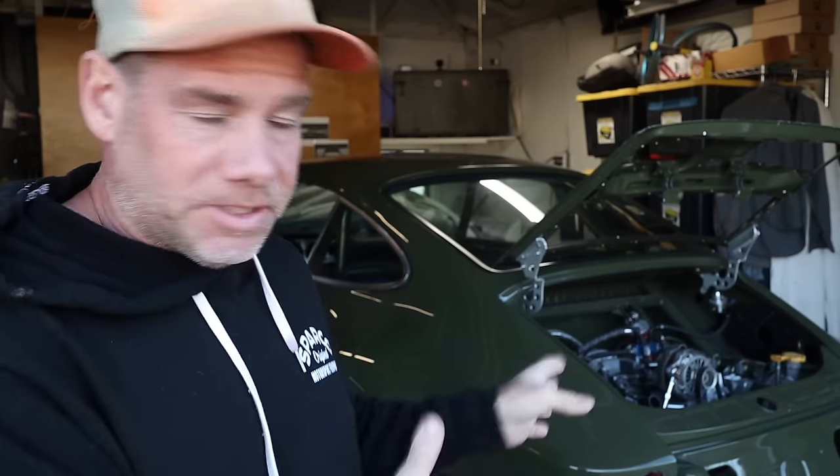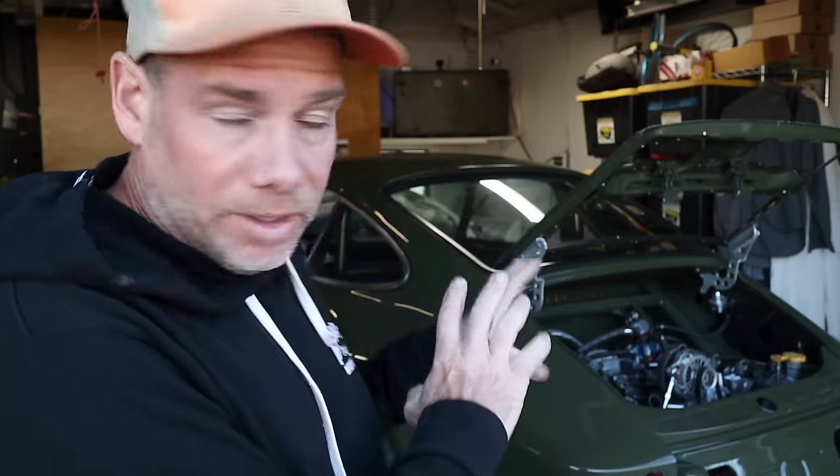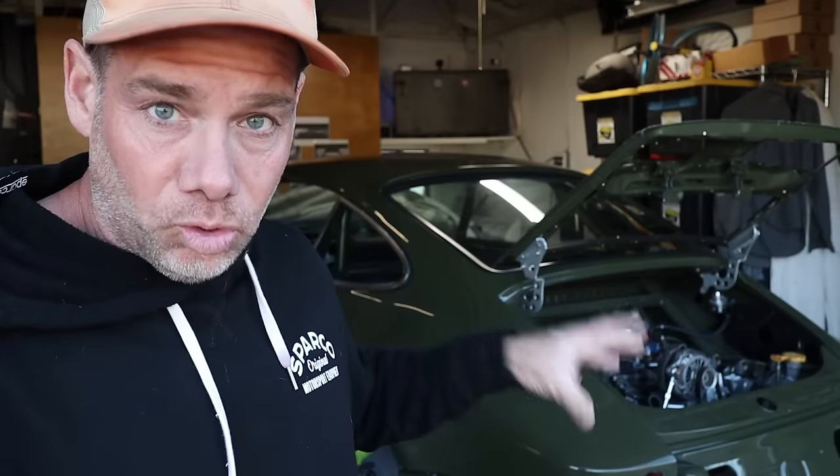But that was only for a couple of seconds, and the reason why is because I haven't had all of my coolant lines installed yet. This particular motor, the EZ30R, has all kinds of different coolant ports that I first needed to find out what they did, where they went, and what their function was — and then how to either block them or put AN fittings into them to feed both the engine and the turbos with coolant. So that has been a bit of my engineering challenge.